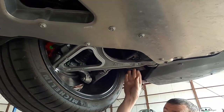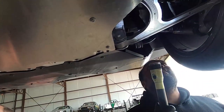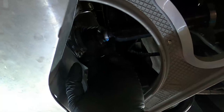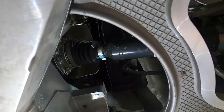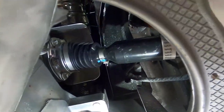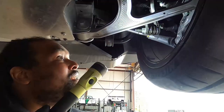You're going to definitely get some flex out of it. Some guys are already breaking axles, but who knows how they're driving. You have this massive center section, and then you have that really sharp taper down — that's probably where they're failing, down at that taper. Needless to say, guys probably aren't being too gentle on them either, but that's got a lot to do with it.